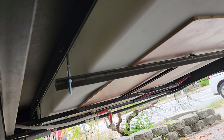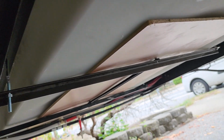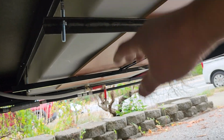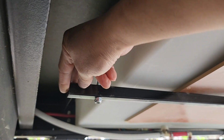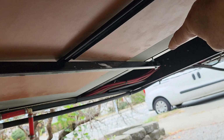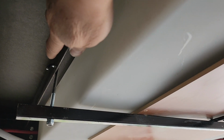So we made this support from the bottom of the water tank. So we use the frame. We use this one, 1/2 inch, 3 feet long, 1/2 inch square tube as a support from that end to this end, and connect to the top of the frame. This is a support for the water tank, the plastic water tank,